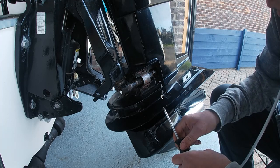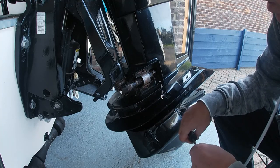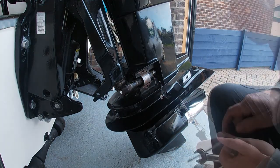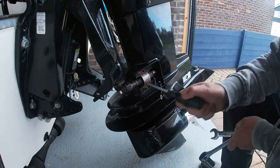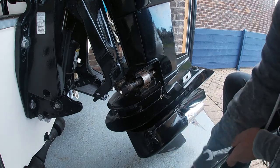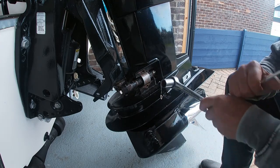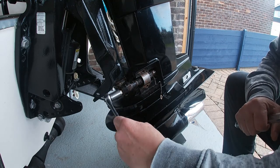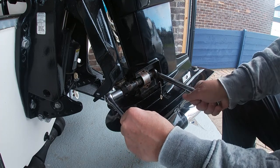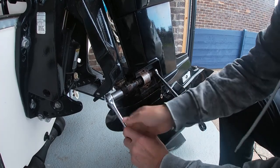What we're going to do today is a trial fit of those new ones. He's not here just yet — I'm just stripping it down ready for that trial fit. The next stage is to remove the engine mount bolt and the engine mount itself. This is where you'll need your 19-millimeter socket and your 19-millimeter open-ended spanner. You can't get a socket on the nut end, so on the bolt head — there's not a lot of room for your 19mm spanner but there is enough.